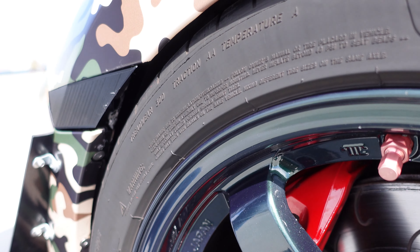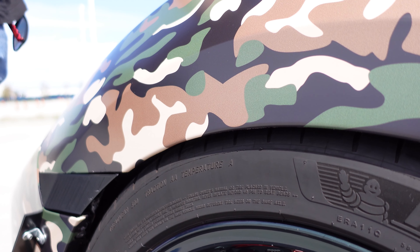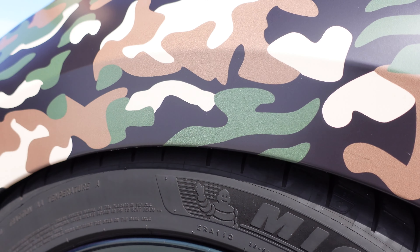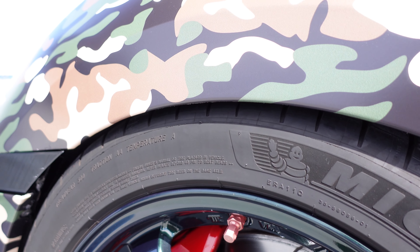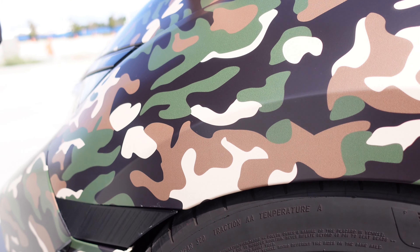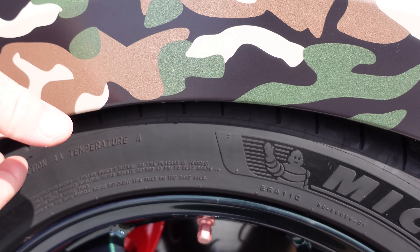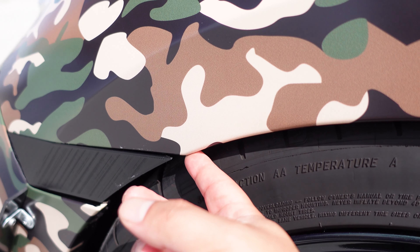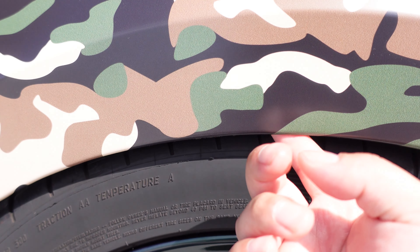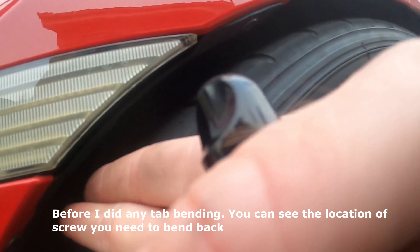It's very thin — just like the rear — but it's metal, not plastic, and that allows you to fit a 285/35-18. I could probably get a 9.5 in there with the same tire, and I could probably even go to a 10. I haven't tracked it with the 285 yet, so I don't know if a 10 is necessary, but the fastest track Type R runs a 10, so that says something. For those running 265s, this is honestly the only location where you rub. You will hit here — metal to metal contact — which is why you do the full fender liner treatment.